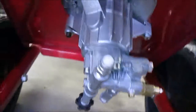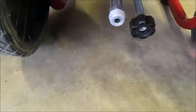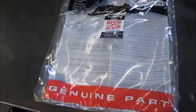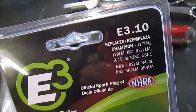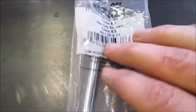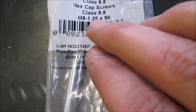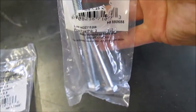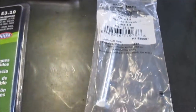Here's the under view — there's those two screws right there and that one bolt right there, and of course it's rear-mounted. I'll hook up my garden hose and then my pressure washer right there. For anybody wondering, this is the part number for the air filter — it's pretty much the only square one that Lowe's has. I cross-referenced my spark plug and got this guy right here. As far as the long bolt I had to use, it was an M8-1.25 by 90. The ones I tried before were hundreds, way too long. The shorter ones were like 60s or 70s, I'm not sure.